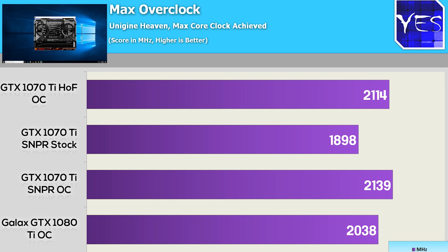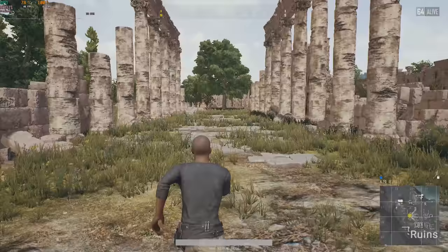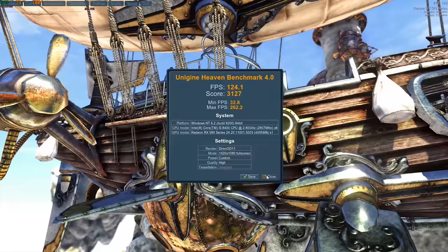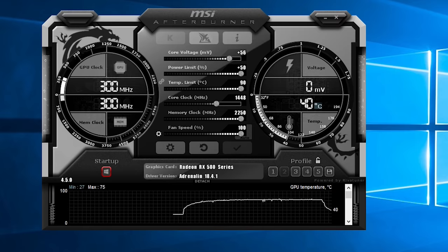But moving over to the ASRock Phantom Gaming RX 580. This out of the box was scoring, I think 78 degrees it got, 100% fan speeds on its max overclock. And then we changed the thermal paste around to GC Extreme, and that got 75 degrees. Not only that, it enabled us to get a very slight extra few megahertz out of the GPU. So this was actually working pretty well, but if it's one thing, it already goes to show that ASRock are actually using some pretty good thermal paste on their GPUs, because in the next test, you'll find out why.